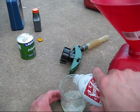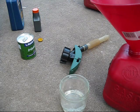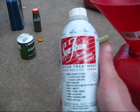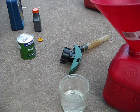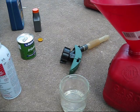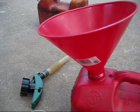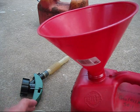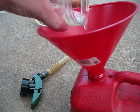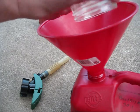Don't worry if you put just a little bit too much — it won't hurt it at all. Not only will Sea Foam stabilize the gas, it'll also keep the engine clean from gunk and carbon crud that you'd see on two-stroke engines. I've got a funnel on my can, so I'll pour all two ounces of Sea Foam in — and we're done.